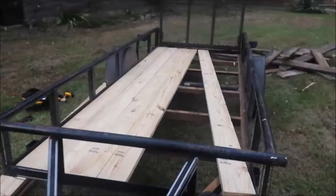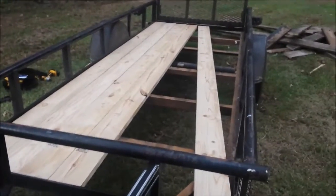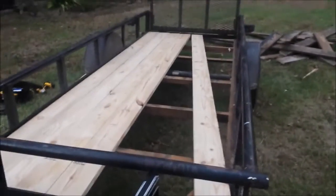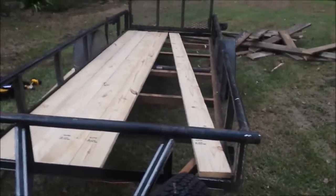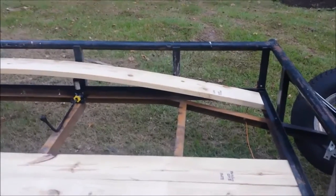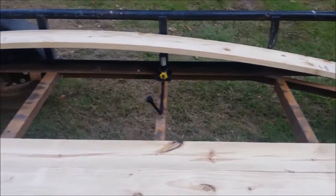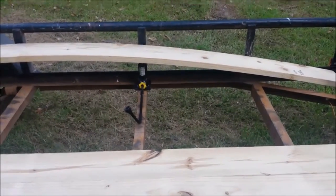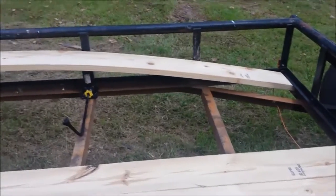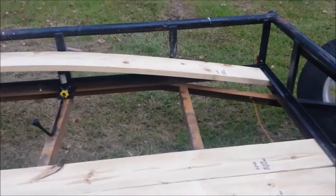I got the first four decking boards in. It's only a 5-foot wide trailer so I'm not gonna have any luck getting the other board in by hand — that means for my last few boards I'll be using a jack. I took a regular vehicle jack; the steel cross beams make it a little safer to work with, though some trailers won't have that. Put the jack about a third of the way from the end.